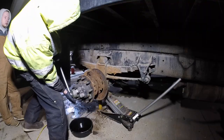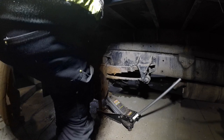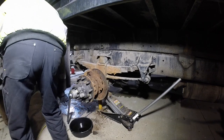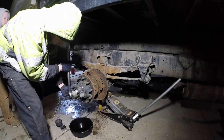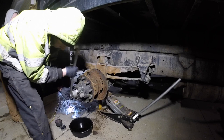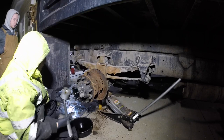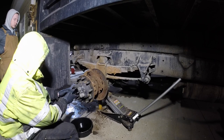Right here you can tell I'm trying to knock out the retainer clip pins and the fingers that hold it on. Finally got that off. Then I'm going for the outer nut — this is an eight-sided, three-and-a-half-inch axle nut that comes off pretty easy.